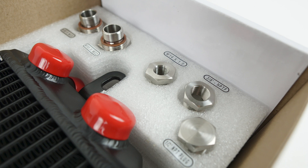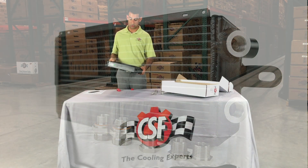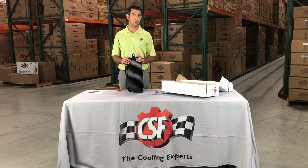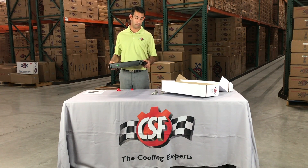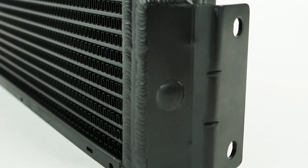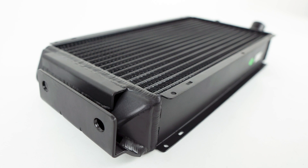All of this is included for a price of $899. It's available worldwide through CSF distributors and dealers. It comes with a 10-year warranty. Some other important features worth pointing out: this is 100% TIG welded. If you look closely at the brackets, there's a weld spot added for strength — we've included that as well. All the mounting holes are actually slotted versus just circular holes like the original, giving the cooler a little bit of play when installing, which installers are really going to appreciate.